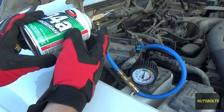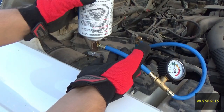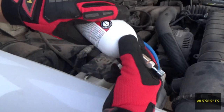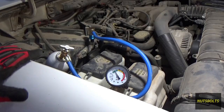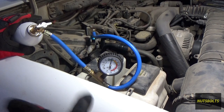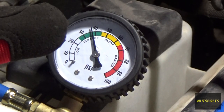As you get to the very end of a can, turn it upside down and shake it to get the last of the refrigerant out. Once the can is completely empty and no longer getting cold, close the valve, remove the empty can, install a new one, open it, and keep charging until you have a proper charge. To make the process go faster, rev the engine to around 2000 RPM — that makes the compressor run faster and pull in refrigerant quicker.